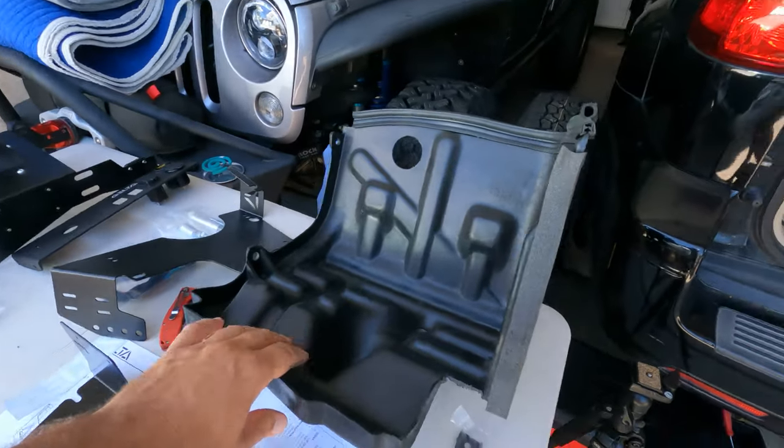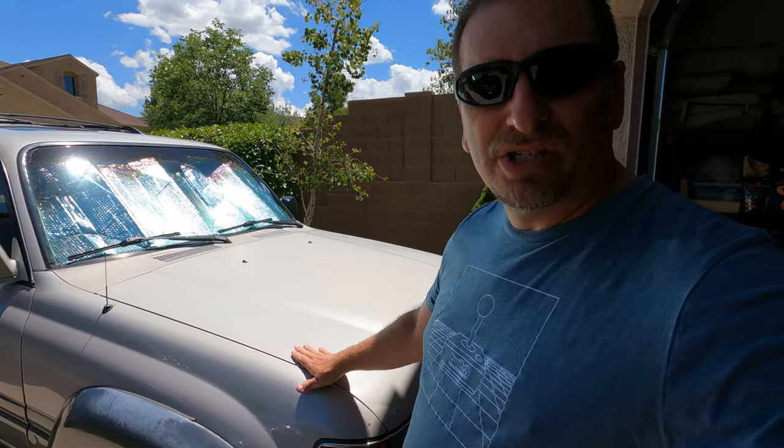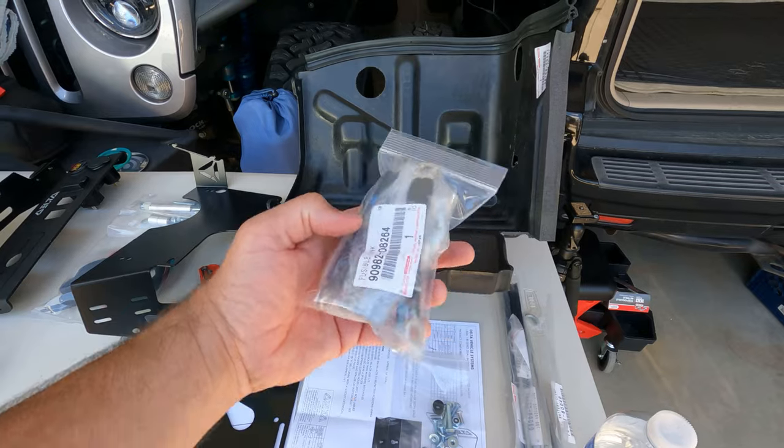I'm going to show you the stuff I have on the table. When I turn the camera away from me the audio gets whack, so bear with me. Right here is a battery box — this is for the early 80 series. In the early 80 series they had the battery on the passenger side with a different engine. On the later 80 series, like this one which is a '97, the battery's on the driver's side. But you can get the old battery tray and put it in here to have the ability to put in two batteries without a bunch of modifications. I've got the early battery tray and its hardware, and I got a couple of those fusible links to get as spares.